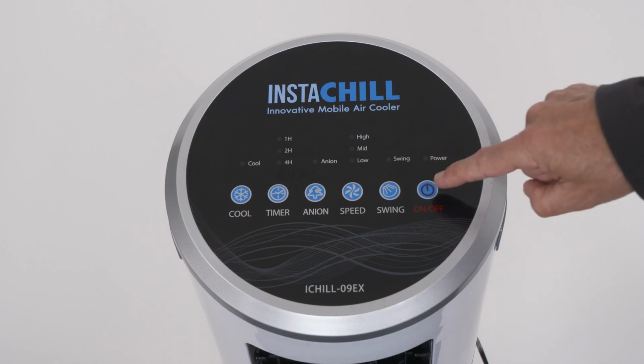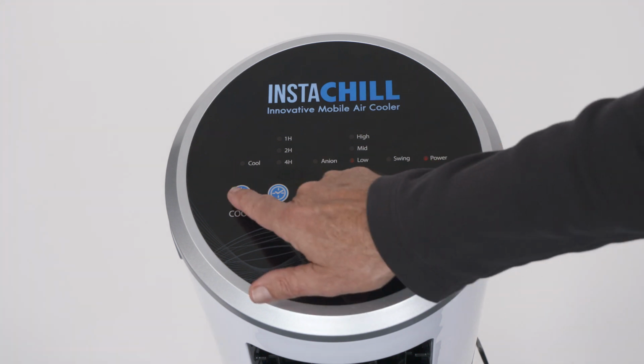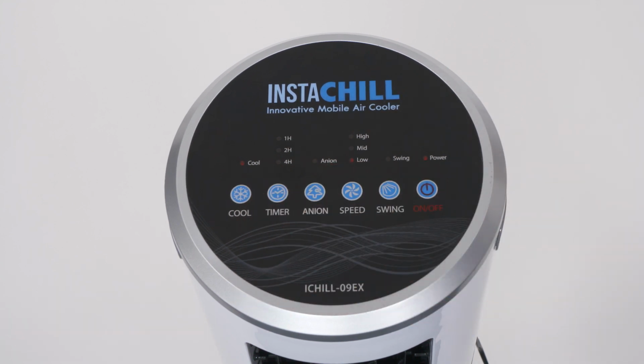You can now push the power button. The panel should light up and the fan will start on low level. Now you will want to make sure the cool function is active. If not, push this button now. This will activate the water pump to circulate the cool water from the base reservoir and through the sponges.